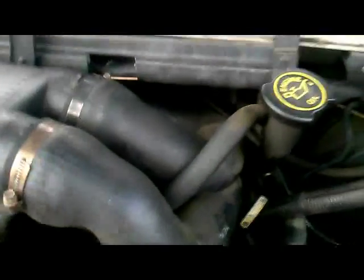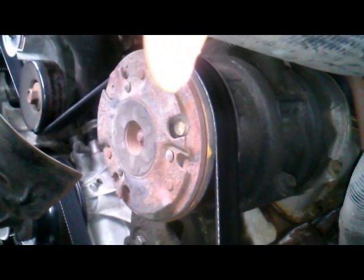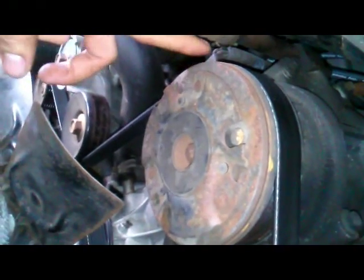Here's my truck. The AC has Freon in it already. There's an evaporator, there's all types of little things, and this here is the AC compressor. You see how it's running on the belt? So this AC compressor is always spinning, no matter if the air conditioner is on or not. I'm going to turn the truck on and show you that it's spinning without the AC being on. This part in the middle will not be spinning, but the pulley itself will be spinning.